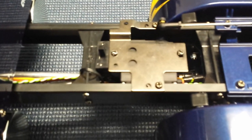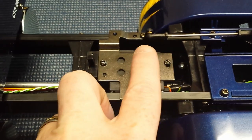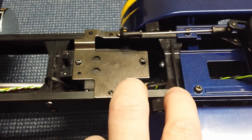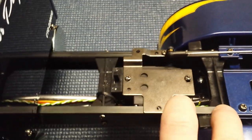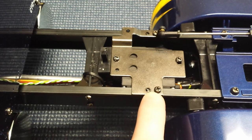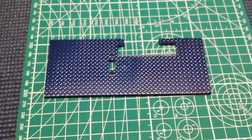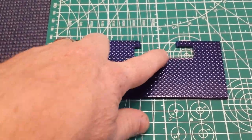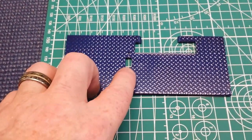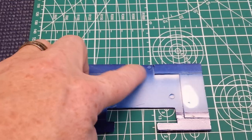Before I get it on the truck, I just wanted to show you this. Previously we had the manual unlock lever plate and a small piece of diamond plate, plus a filler on the front. Now that we have the servo mount in here - which sticks up above the bed rails - I had to make a new piece of diamond plate. This notch here is for the servo mechanism, and the bit that sticks up above the frame rail has a little cutout for the switch mechanism.